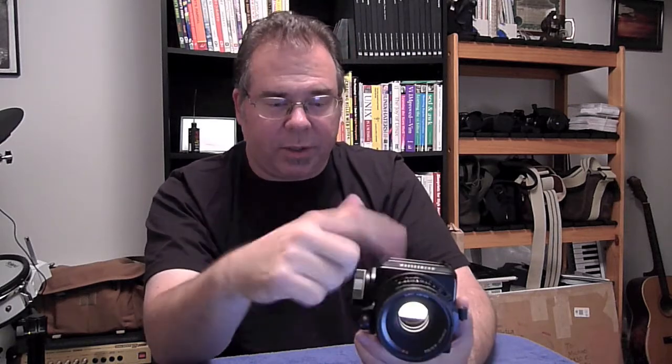Now I'm going to change the aperture a bit and wind again — looks good. The point of that is to make sure the front shutter in the lens is working, the aperture is actually shutting down when it needs to, and that the rear shutters are opening.